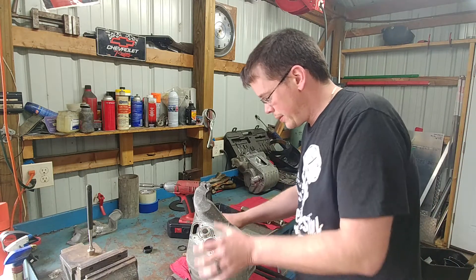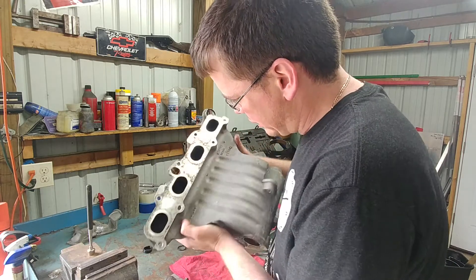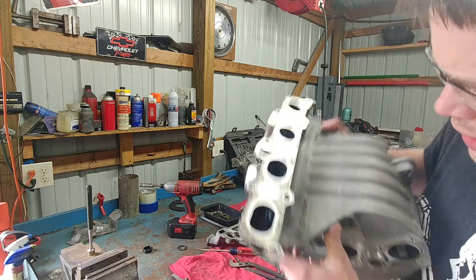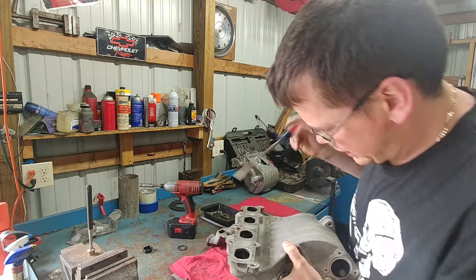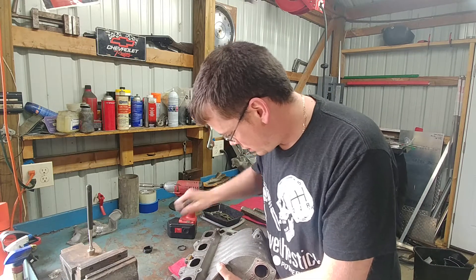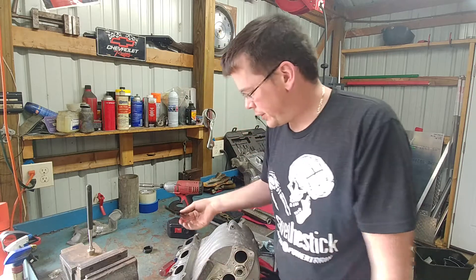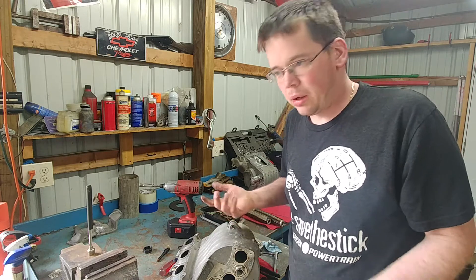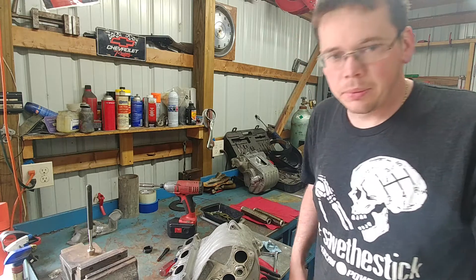There's a lot of oil in there from the PCV. Inside there's a little lip on the PCV valve — take your screwdriver on that lip and just pry up on it. That pops out your PCV valve. Hopefully this helps somebody. I might put a video together about how to assemble it, and there you go — thanks guys.